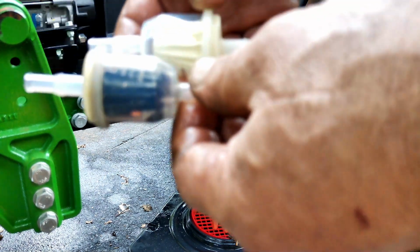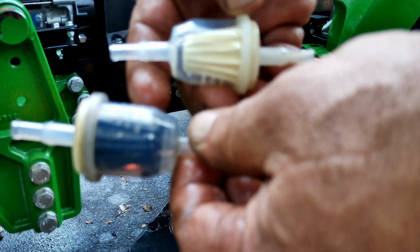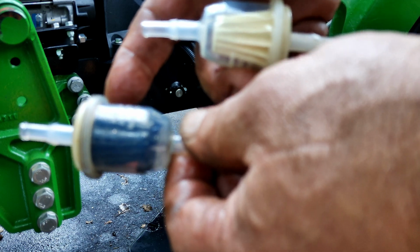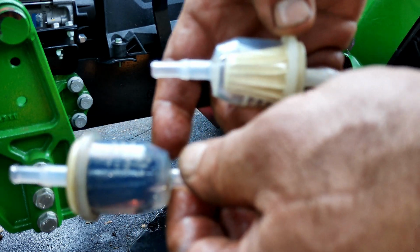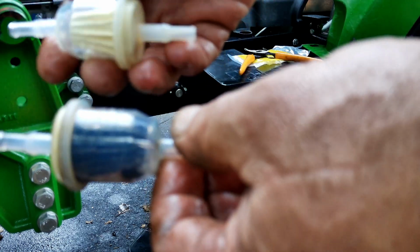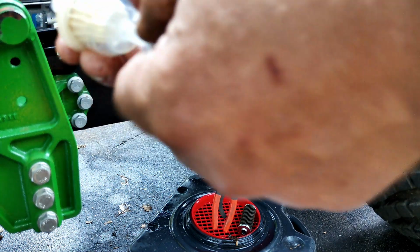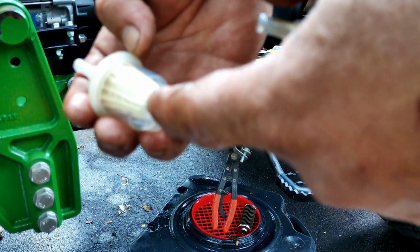If you ever have a runnability problem with your tractor, it's probably this filter, even if it doesn't have a lot of hours. On my 1025, I had fits with this thing, but that was because at that time I was using jerry cans and they weren't the cleanest. The other thing is there is a direction of flow. There's an arrow here and it's pointing that way. So the skinny side has to go toward the fuel tank. And that matters.